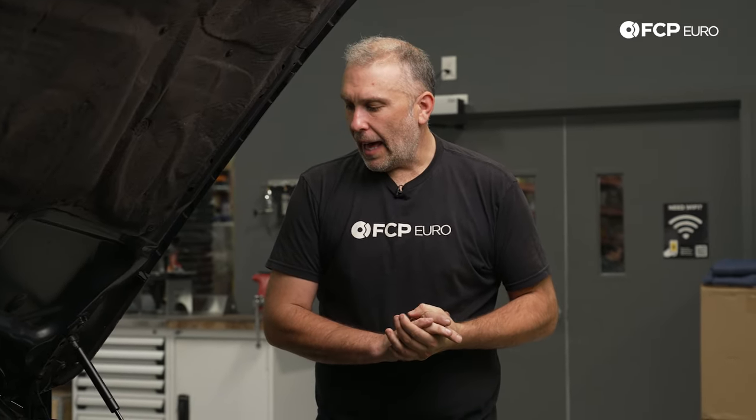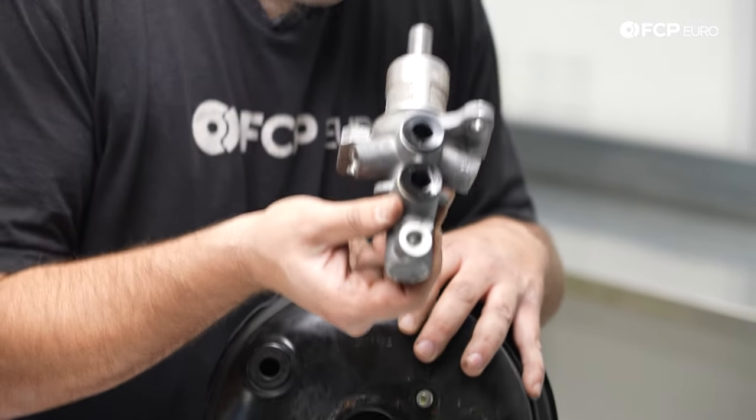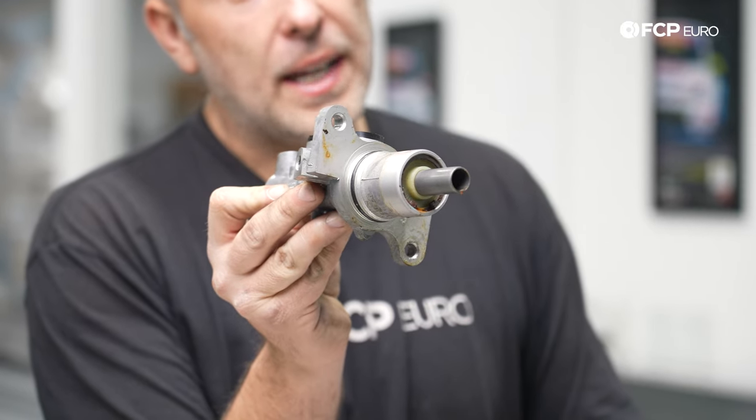It's a little bit of a weird diagnosis, because usually when you have a serious issue with your braking system it's a little more obvious. This is really more of a feel situation, which is open to interpretation, but I can definitely feel where the owner doesn't like how the brake pedal feels. It's been bled multiple times with no air coming out of the system, so we know that's not a problem. The brake pedal feels mostly okay, but it's softer past the point where you'd expect it to be, which ultimately leads me to the conclusion that we have a worn master cylinder. Brake master cylinders are an item that is typically not replaced and often misdiagnosed. The brake booster is good, the brake hydraulics are sealed with no external leaks, and the brake calipers are good — it just needs a brake master cylinder.